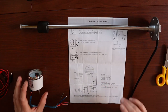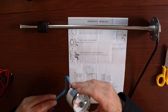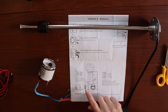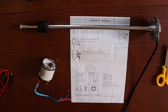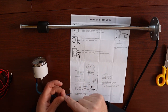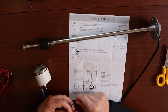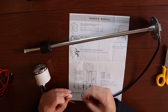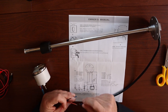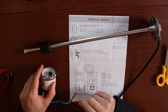Before installing anything, let's check and see how it all works. We have our gauge clock, which has four wires, and our wiring diagram, which is actually quite clear — as long as we read the English version, not the Chinese version. The red wire, power between 9 and 32 volts, goes to positive. The black signal wire we connect to the brown wire of the sensor. The blue wire is ground, connected to the negative of the battery and also to the blue of the gauge. The orange wire we'll see later — it is the backlighting.